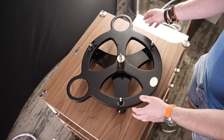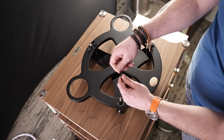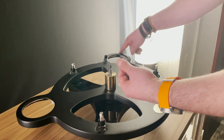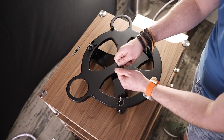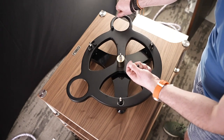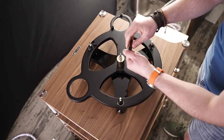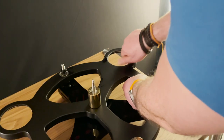When you're roughly in position, you can now work on putting the tone arm and arm plate in place. To fit the arm plate, we supply three Delrin arm plate spacers and screws. Unscrew the screw from the spacer — each spacer screws into the three tapped holes on the right-hand side of the chassis. They don't have to be really tight, just finger tight; it's quite a delicate thread and any torque can snap the spacer away from the thread. The reason we use these spacers is it decouples the arm plate from the turntable chassis — no metal-to-metal contact — which gives a subtle improvement in sound quality.